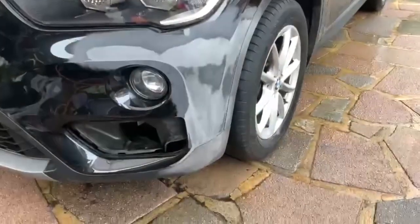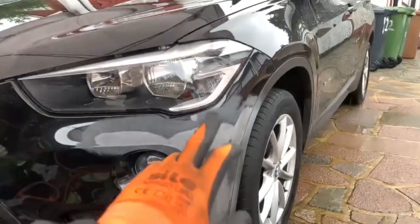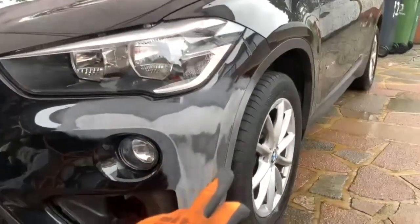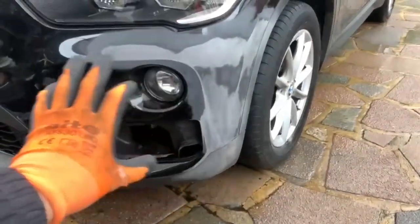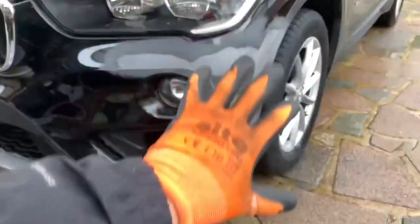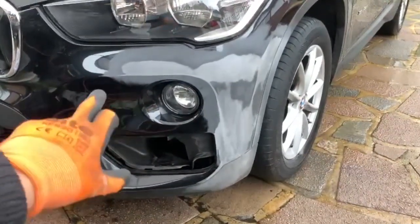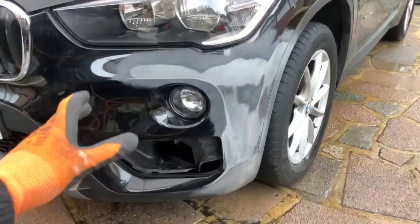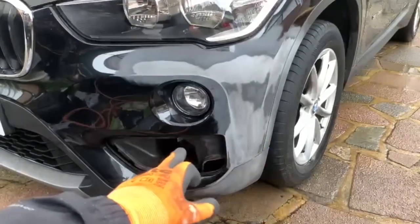Okay, so the first part of the preparation process is complete. As you can see, the painted area up here has all been sanded, and the trims have also been sanded above and below. What we'll do is prep the complete job together — we need to key up these areas here that are shiny, because if you spray over shiny parts of the car with new paint, all that will happen is it will delaminate at a later stage.